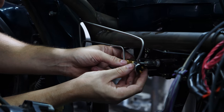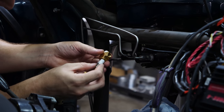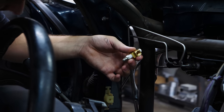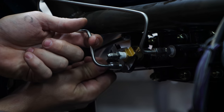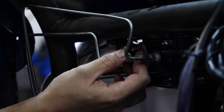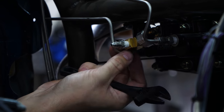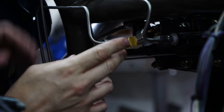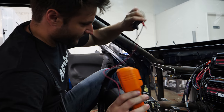The plan here: this block goes into that piece, the sensor goes in away from being kicked, the original piece goes back in here and pulls this out a little bit — I already checked and we have the room for it. Tighten it by hand, put this one in, and finally the switch goes in last. I can never get MPT fittings on just right — they're just a pain in the ass. This goes on here; the only thing I'm worried about is air getting into this. But the brake pressure switch is all installed.